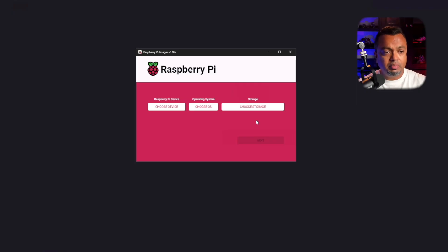There's also a fan built into the case for heat management. The way I'm setting this up: I'll still use the SD card for the initial configuration and boot, to update all the Raspberry Pi software. After that I'll clone everything from the SD card to the NVMe SSD and then adjust the boot order. Note that in the Argon Neo 5 case, the SD card slot is not accessible from the outside once the board is mounted — you'd have to dismantle the case. So I'll use the SD card for initial setup, preparing it with the Raspberry Pi Imager software.